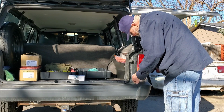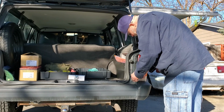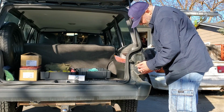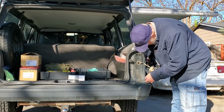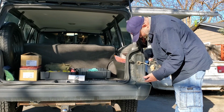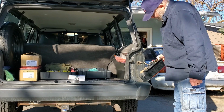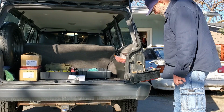So anyway, there's 3 bolts and a tab on the bottom, and if you don't know how to get it out, you can break the tab off. And I found when I inspected this Jeep that tab was broken off. It actually goes in a slot here, and so you have to pull out instead of up. And when people pull up, it breaks this off. Probably would be fine, but replacements are still available and they're pretty cheap.